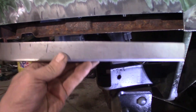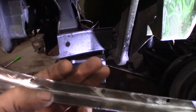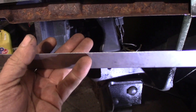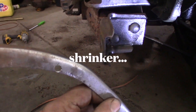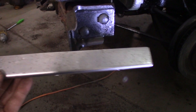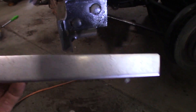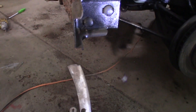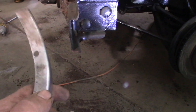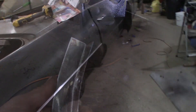It looks like I got it — this piece fits in there just swimmingly. Looks like I'm going to be able to weld it in there pretty tight. I put a couple of holes in the bottom so I can do rosette welds in there and get it caught. I couldn't have done this without the shrinker stretcher — without the stretcher part of that, I just wouldn't have been able to do that. Making the bend was easy in the brake, and cutting to length with the shear is nice too, but you can use snips and bend metal over an edge of steel. But replacing that shrinker stretcher — I don't see how I could have done that. So I got it ready to go — I'm going to clean it up and hit it on the backside with some primer. Hope you guys liked the video — like, share, and subscribe. We'll see you on the next one.